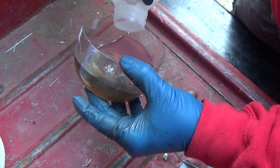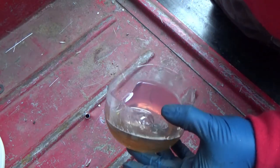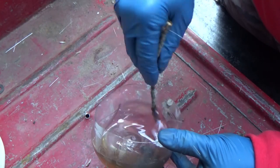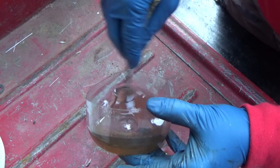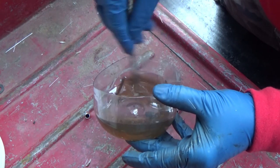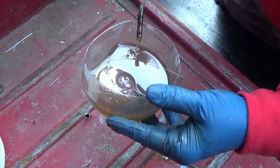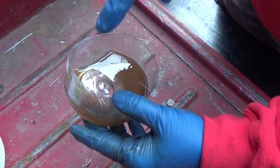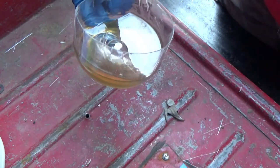The kit's catalyst looks to be a slow cure, but I know this one is a fast cure - it takes a lot less of this than the other stuff. I'm gonna put just a little dollop in - we're talking just a tiny bit. Now only do this if your catalyst container is clean. If there's kicked or hardened material on the bottom and the resin you're adding is still liquid, don't use it - because then you've got two different mixes of catalyst going and it gets pretty unpredictable as to how fast it'll cure out.